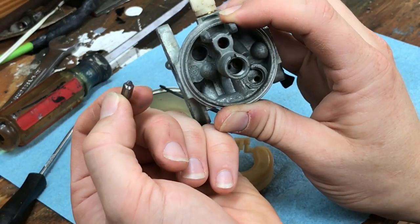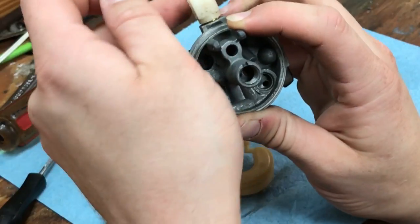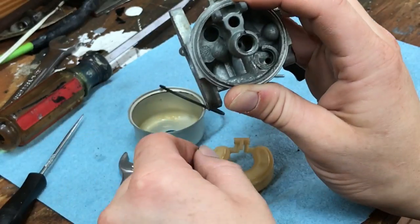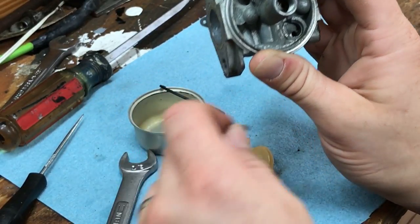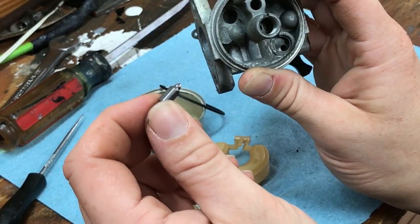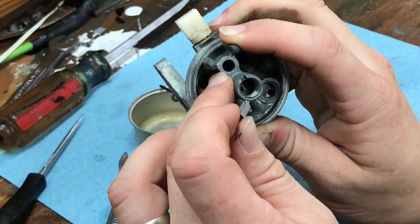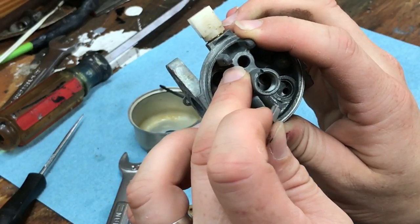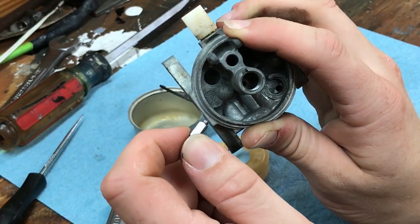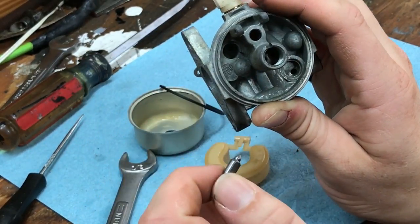This is what is referred to as the needle and seat. The needle and the seat in there — that's where the fuel comes in through this needle and seat. It operates as a valve to control how much fuel is coming into the float bowl. The float monitors how much fuel is in that bowl so it doesn't flood itself out. The seat is sometimes made of a plastic rubber polymer type material, and sometimes you'll see them made out of brass — the needle and seat meet together and that's what controls the fuel flow.